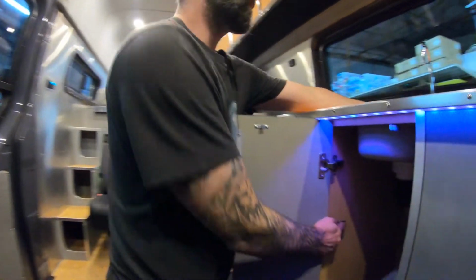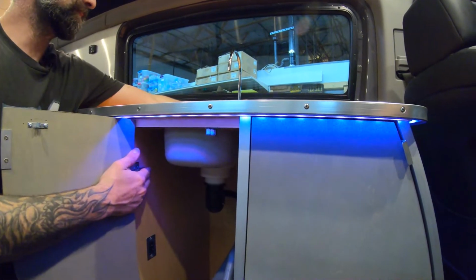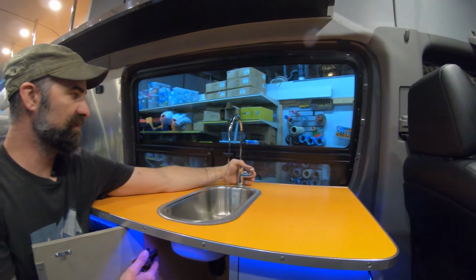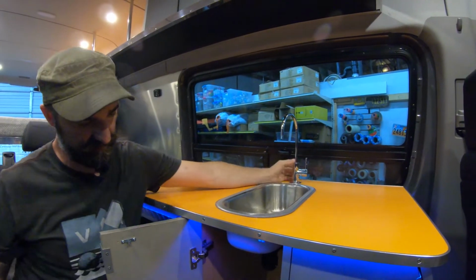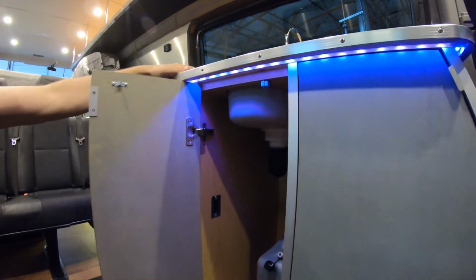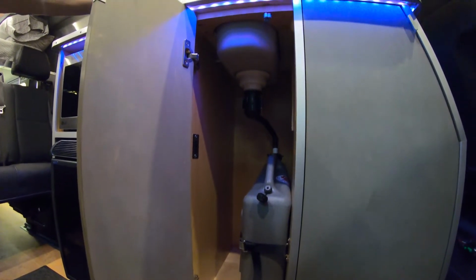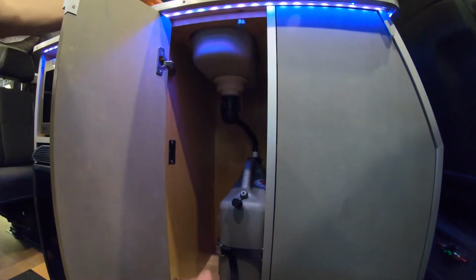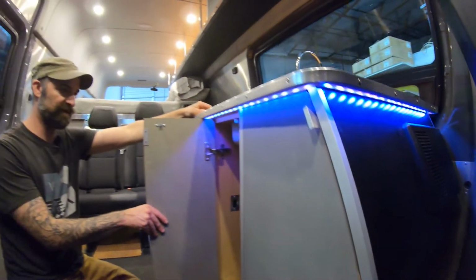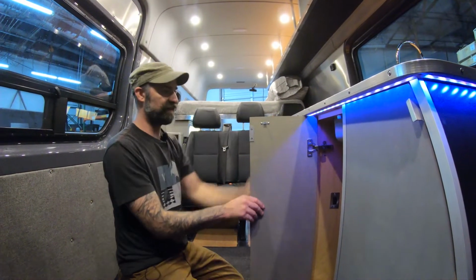This right here, we have a secondary switch for your water pump. So you can see, same thing, grab a glass of water, brush your teeth, wash your hands, whatnot. You can hear it draining. So it's just got this little 7-gallon catch right here. All you have to do is release this. If it gets full, dump it in the gutter, whatever. It's just gray water, hopefully nothing gross or toxic in there, but just check it every once in a while and see if it's gotten full.